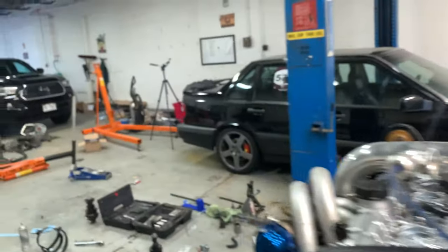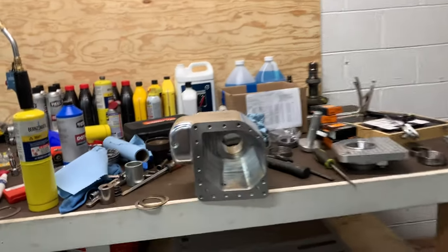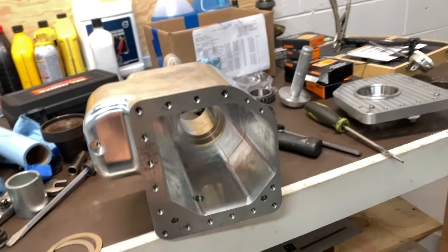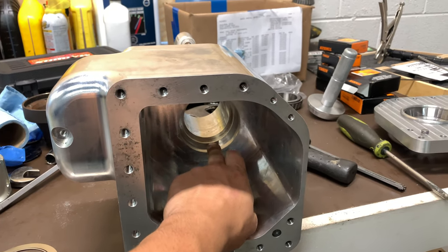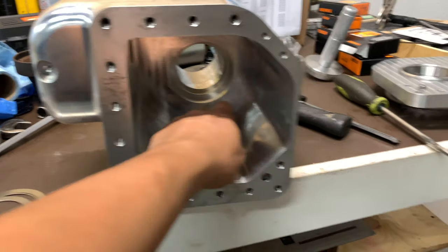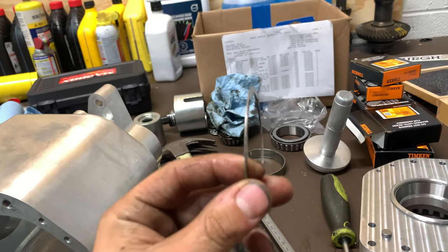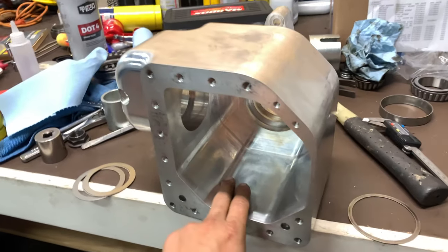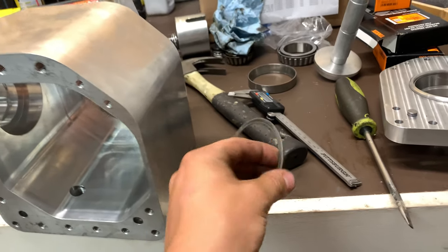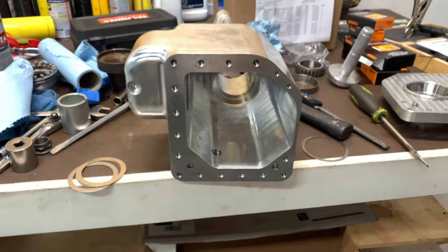I think whenever I set these cases up, I'm always going to be able to use 1.5 millimeters for the pinion depth shim. Then you just have to fine-tune the ring gear shim to set the backlash, and that should give you a perfect contact pattern every time. I'm going to put the 1.5mm worth of shims in with the new inner pinion race, then the new outer pinion race. The ring gear preload adjuster race is already in, so the plate is all good to go.